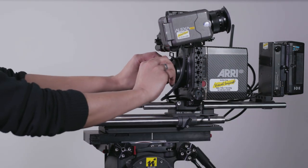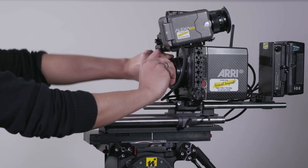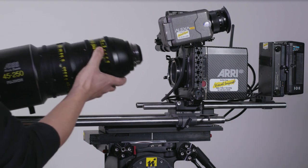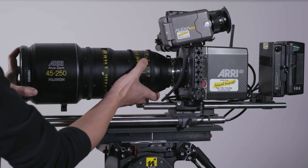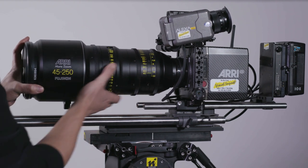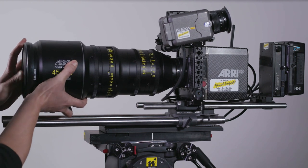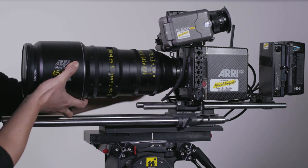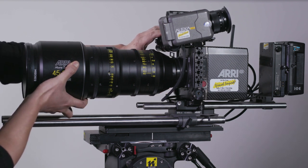Carefully remove the lens cap from the lens mount on the camera and cover the exposed sensor with the palm of your hand. The next step involves aligning the lens with the PL lens mount. It will only go in one way into the PL mount and you'll also need to support the lens with one hand. Because of its size, you can expect a bit of a wiggle before locking the lens mount lever, but once you do so, the lens should be locked securely.